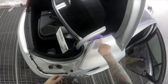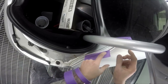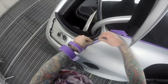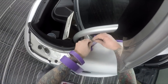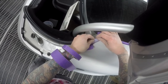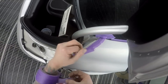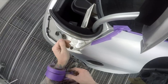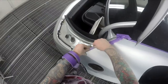Things like this — you can do a bit of a false edge there if you like, but a lot of the time all you really need to do is just back mask and then peel it back a little bit before you shut the panel. What can happen is sometimes it'll go a little bit too far, but as long as you're taking it back there before you shut it, it'll go back easily enough.